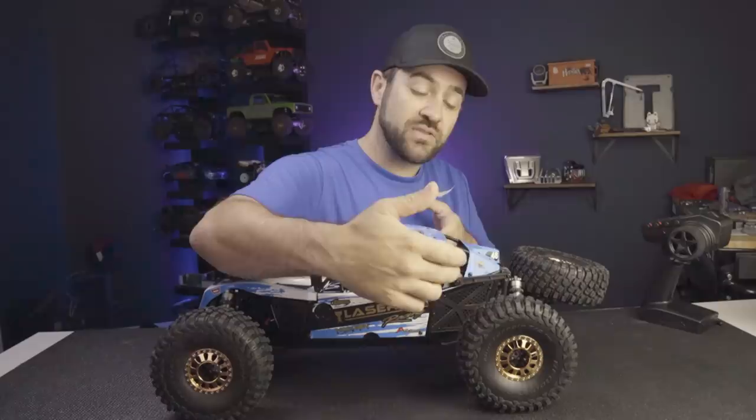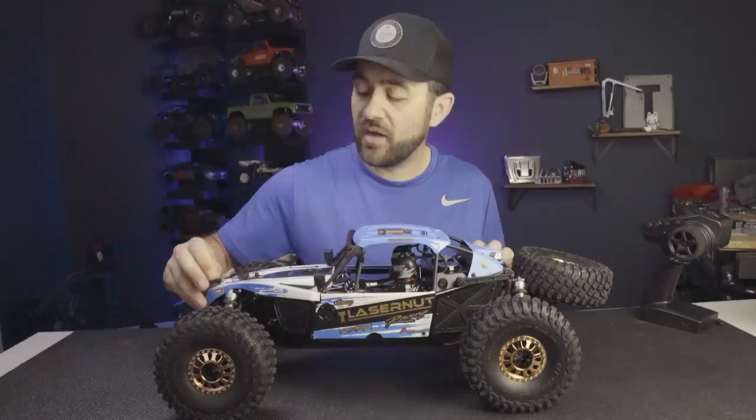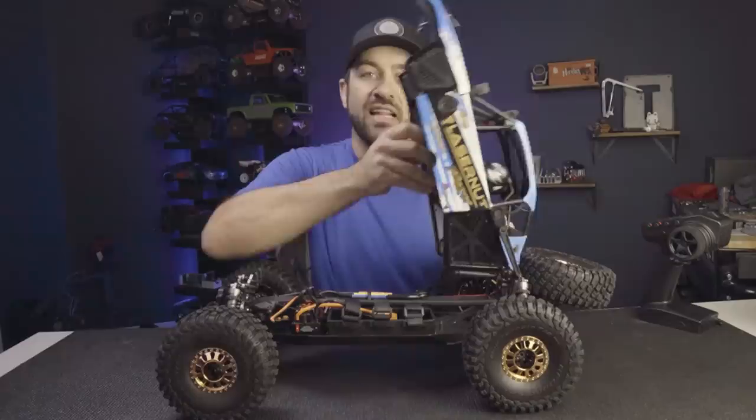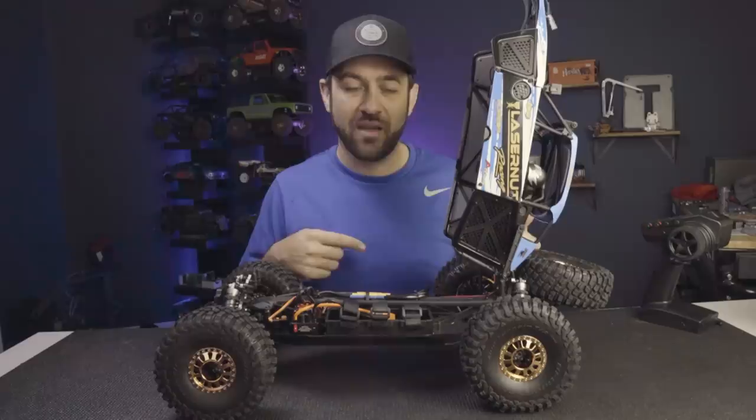So it mounts through this cage and then comes back, and the swivel point for the sway bar also lines up roughly with the hinge point of this whole cage. So if you pull two of these body clips in the front, this whole cage now will lift up. Since the rear swivel point for that sway bar is in line with the hinge, that allows everything to function properly. Another nice feature of this sway bar, that I have to assume is kind of a happy accident, is that you can just flip that sway bar a little bit forward and then the body won't come down,